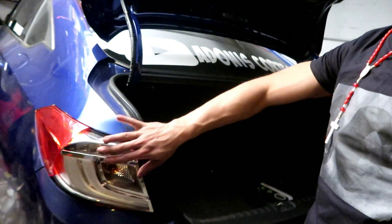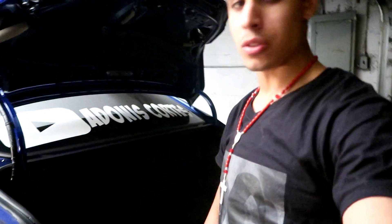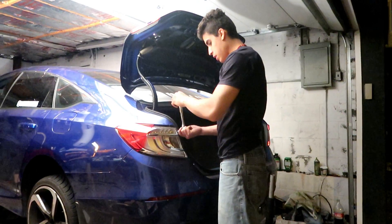I'm going to show you guys how to do the extended studs and I'm also working on the taillights today. As you guys saw, these were broken — we're finally going to change them and replace them with the new ones. I'm going to show you what I got. For now I'm going to take these old ones out because I'm tired of seeing it shattered. I'm pretty sure I've got to remove the cover in the back of the car. I already removed the black cover, and after you take the black trim off there are two bolts holding the light — they're a size eight — so I'm going to take those off right now.